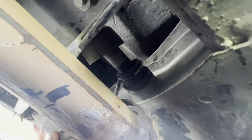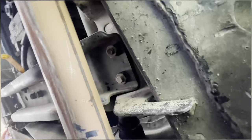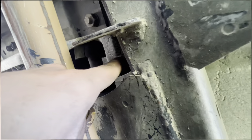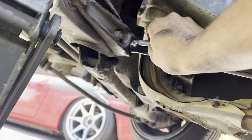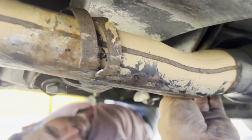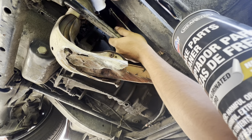The driver's side is a little bit harder since the exhaust is right here and the c-clip is right in there, making it more of a challenge. To remove the c-clip, get two flathead screwdrivers, put one on each side, and push with both so it opens up and pushes back — if you only hit one side it'll just spin. On this one the opening gap was on the top, so I had to reach above the crossmember and hammer it until the opening was on the bottom so I could pop it out. Clean it really well, get rid of all the grease, then mark your reference line.